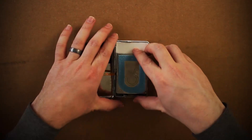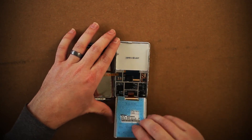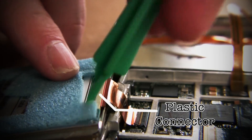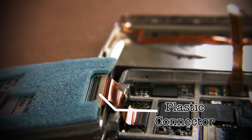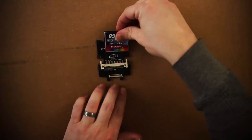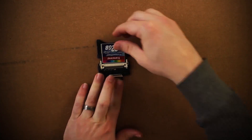There's the hard drive. What you want to do is lift it up and kind of swing the hard drive down so that you can see the ribbon cable attached to it. You can then detach it by lifting up this little piece of plastic and carefully removing it.